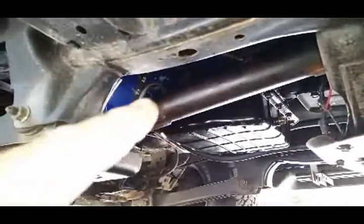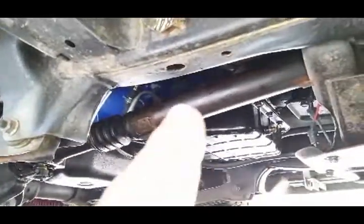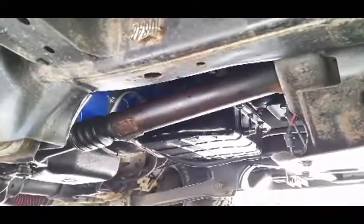So, up underneath here, transmission is in. Got our transmission lines, you can see them hooked up there. Used part of the factory, ran around that side to avoid the drive shaft. There's our plug to drain the fluid. It's not in the best spot with the skid plate right there, but she works. And then as you can see, the lines come back around the back side of the painted transfer case and they go up into the frame rail.